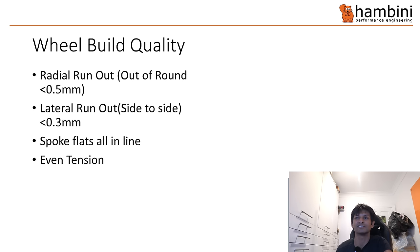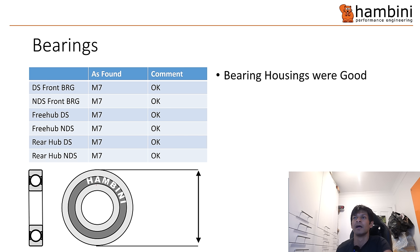There are pictures on my website at hambini.com. These are the bearing seats — if bike shops knock them out, clean them and put them back in, I really would not recommend that. I've recently had a couple of insurance queries where the bike shop was held liable for doing it and they've paid out. If you're a bike shop, don't do it; if you're at home, do whatever you want. M7 is pretty much run of the mill — it's an interference fit with the tension on. Some hubs have M5 which is quite impressive for that kind of structure, but M7 is fine, there's no issues with that.